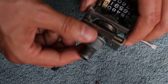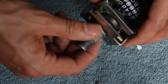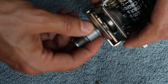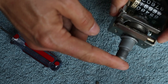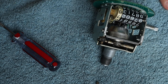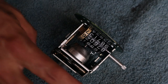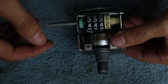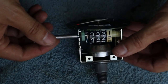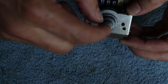My plan is to try and reassemble this. There are a couple of tabs on the end that line up to grooves in the plate, so I need to find the right orientation and shove this back in properly positioned. I'll try some kind of epoxy or glue — maybe JB Weld or E6000. While testing the glue, I also worked on lubricating everything using some 3-in-1 oil in the mechanism and Napa Silglide brake grease on the exposed gears.